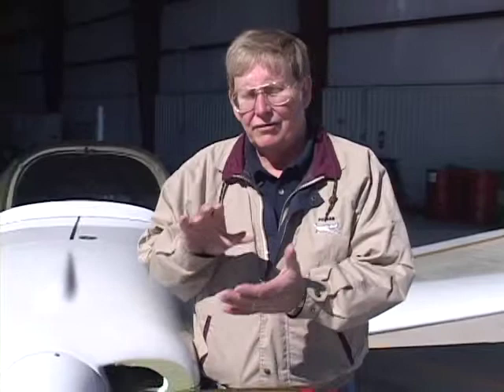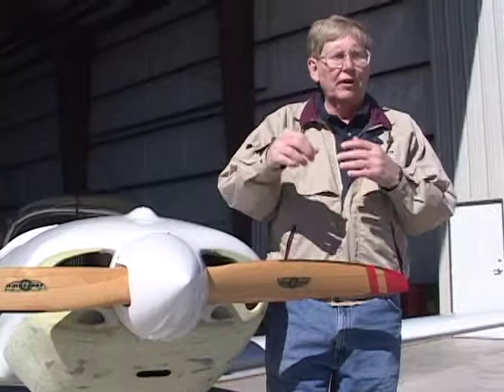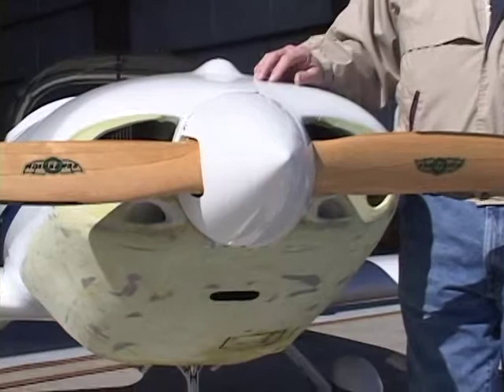I ordered the engine out of Australia — that's where the Jabiru engine is built. While I was waiting on that, I had the plane at home and started the teardown procedure to remove the old 582 engine and engine mount. It involved some extensive modifications to the cowl. The cowl is very aerodynamic and fit the 582 very closely, so when you put in the Jabiru engine — which has an oil sump that's quite deep — I had to modify the cowl to accommodate that new oil sump. The muffler is on the bottom side right behind the oil sump, taking up a lot of room that wouldn't be contained in the 582 cowl.